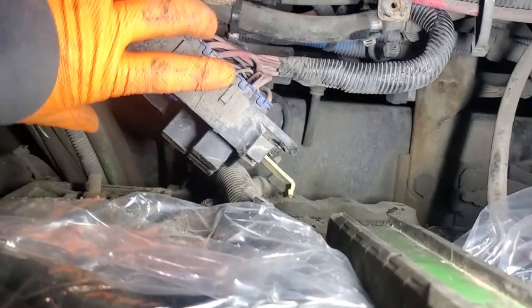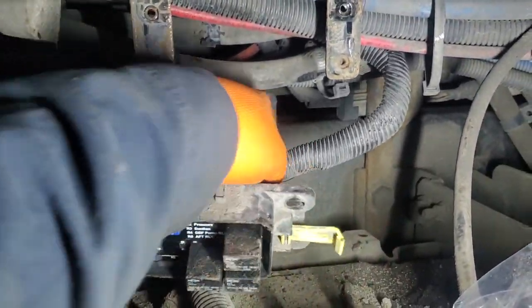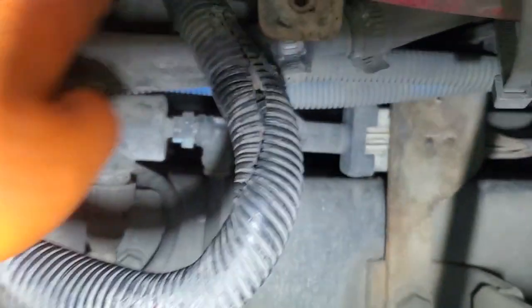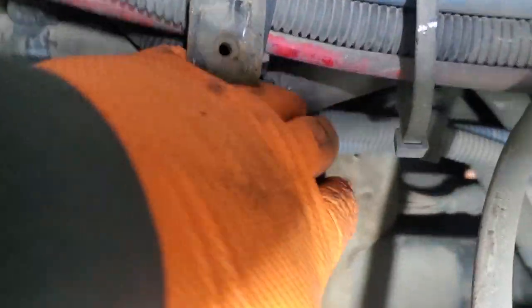This is your after-treatment PDM, it's mounted up here. Unbolt it and follow this harness — you'll see it's rubbed through in a couple of spots here. I already pulled this off and checked it out, but keep pulling it down and look at that. How it's routed around here is prone to some pretty heavy-duty rubbing. There are brackets and clamps up there.